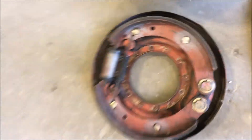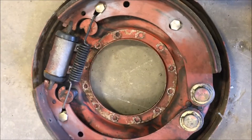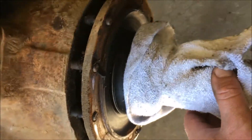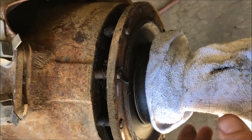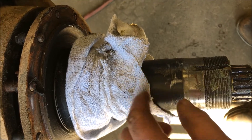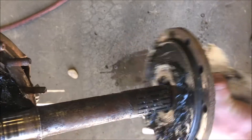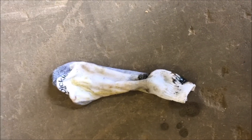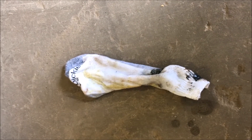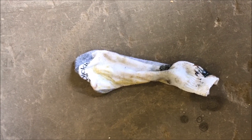Here's the backing plate removed. It comes with a little spacer — all that's junk, it can go in the scrap bin. Here's the spindle broken loose. It'll sometimes take a little effort to get it free. You can tap on the end of the spindle, just make sure you use a plastic hammer — don't hit this with steel. Wiggle it loose and slide it off. Once you're done pulling the spindle off, you can remove your sock from the bearing — it'll stay clean now.